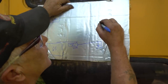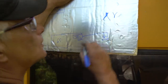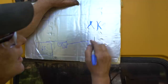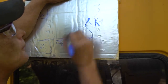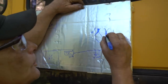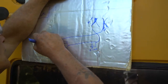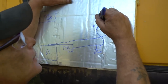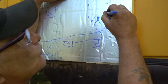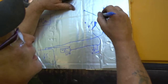So the diesel comes up this way. It comes off from the fuel filter up to the delivery — the normally closed side. This one here is a return on the normally closed side and goes back to the fuel tank — that's your diesel side. Now this one here goes up and feeds the head here and here. You got a return here and here. The returns go into here and the feeds go into there.